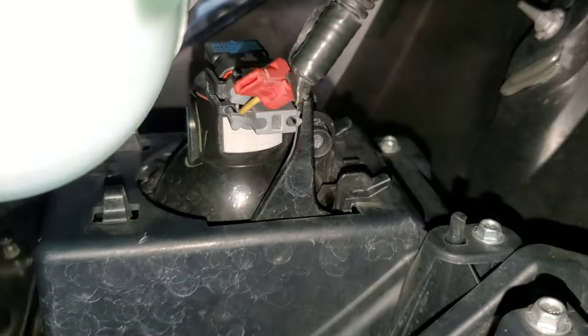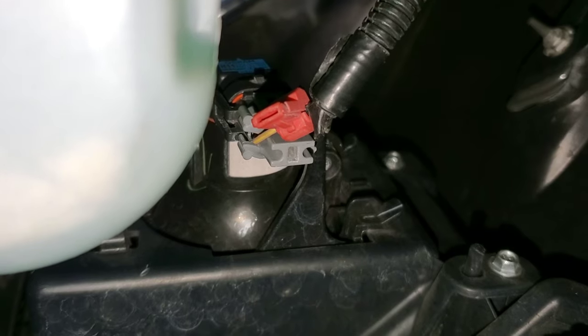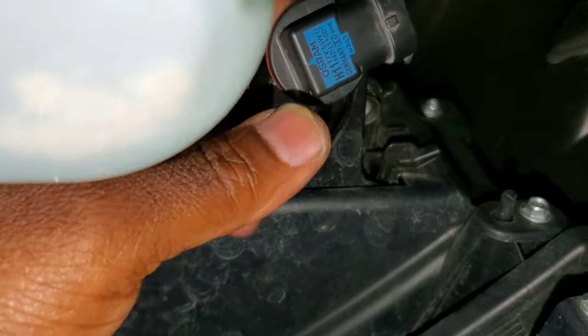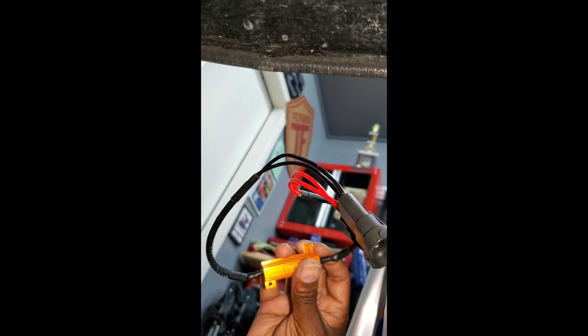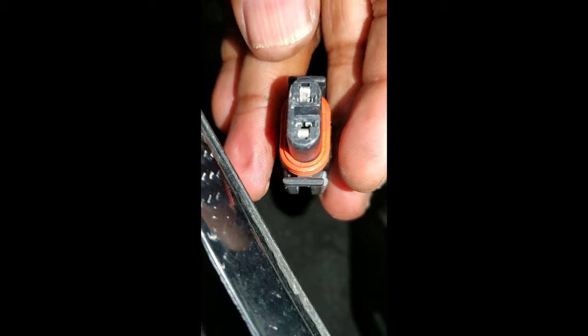We're underneath the car. And as you can see up there, you can see my fog light housing. You just want to unplug the clip and then twist the bulb out. Okay, now you get the bulb twisted. Then you want to take the stock bulb out. Now you want to get this and do the same thing — stick it in, twist it. Now you want to get your driver and plug your driver in. It went into this one and then went into the factory harness.